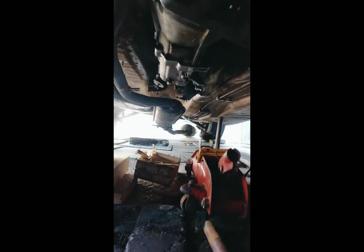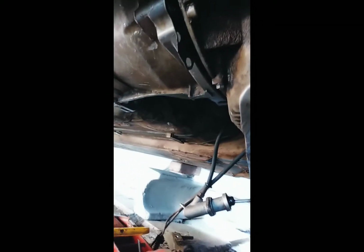I'm just about to pop it in right now, tighten up the nuts, clean off the clutch slave cylinder a little, put that back on the gearbox, and then let my son help me bleed it. He can do the pumping, I'll bleed it from the bottom. Then tighten up the prop shaft and everything, and give it a test. Actually, I'm just going to tighten the gearbox, put on the clutch slave cylinder and the reverse light fitting on the box, start it up, and see what the reaction is on the car first before I tighten everything up.